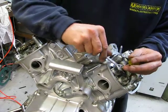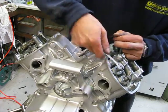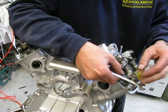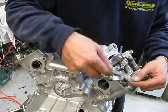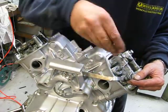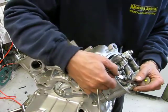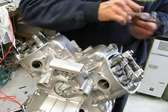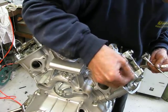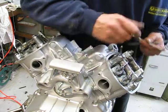That's too tight. That should be fine. Intake: 0.08mm. Whatever that is in inches, figure it out yourself because I do everything metric. Always check if there is clearance. I can't let you hear it, but there is clearance.